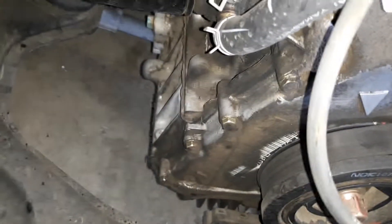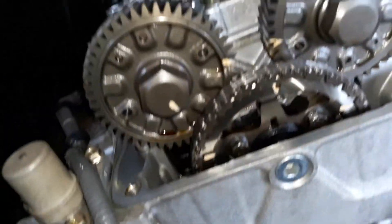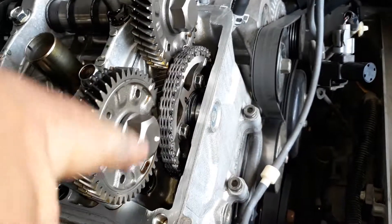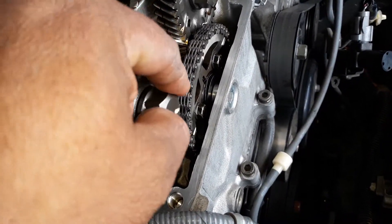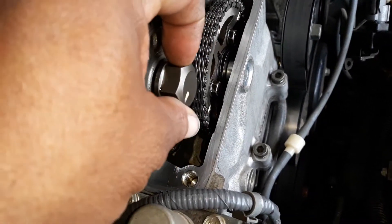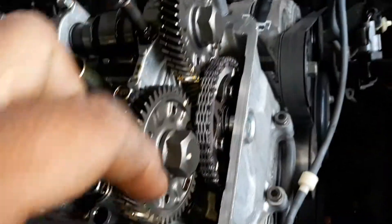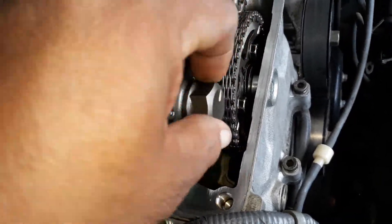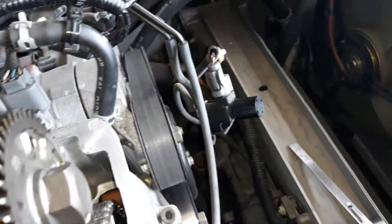All this that you're seeing is going to be cleaned up. After I took out the valve cover I was dabbing some oil off the surfaces of the head and I accidentally pushed on this — and it turned. This one is not even torqued on, it's just spinning freely. That one's torqued on because I can't turn it, but this one's spinning freely and that's not good. So we're going to have to put the proper torque specs on that.